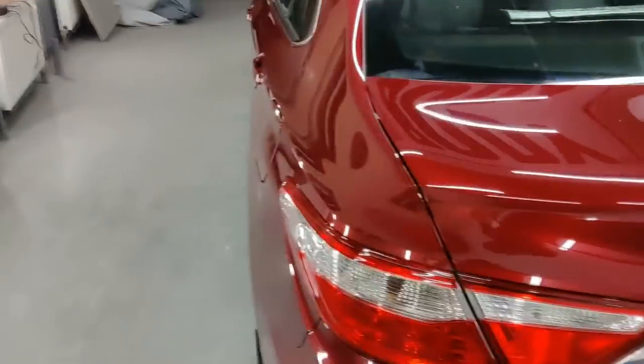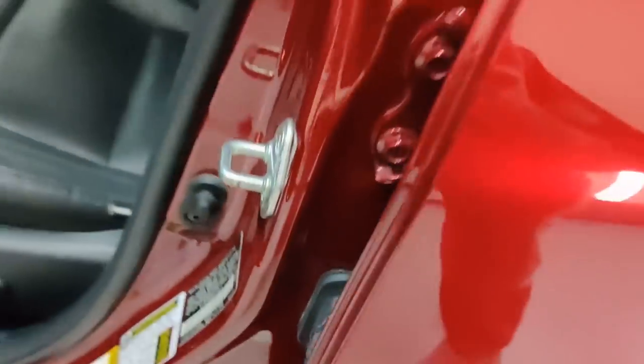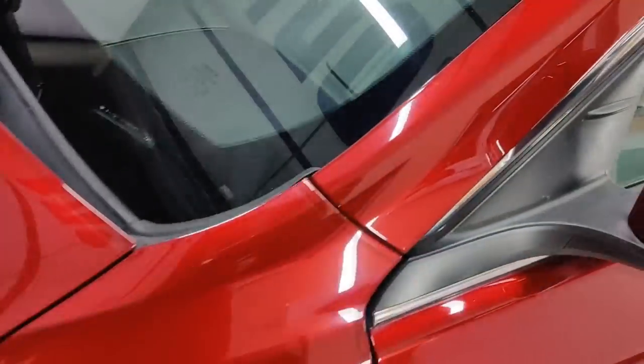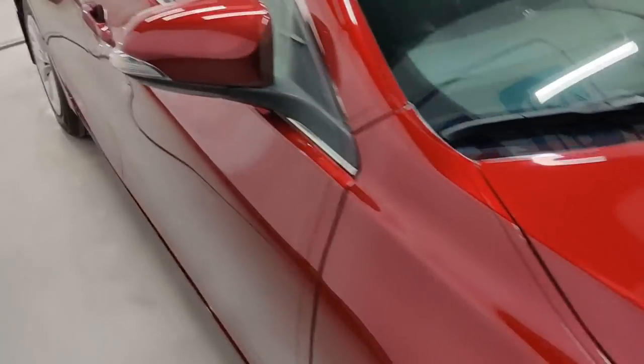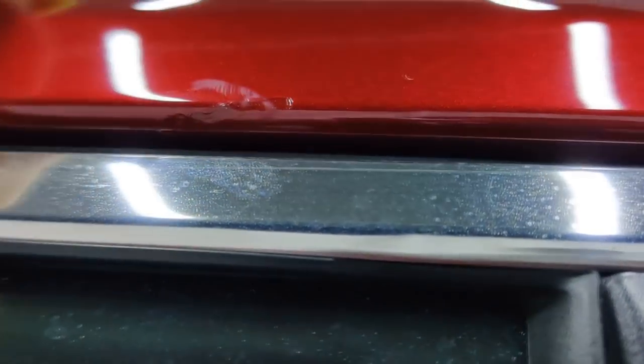The machine is polished. Being prepared dry now. Will degrease shortly. We'll do another pass, correct a few more spots. There are places like this little dot — it's purely base coat. I'll mix hardener and lacquer into the base, 10% each, and go correct it. What wasn't visible at first. In principle, everything is done on the car. The light caught fairly well. There's a dent showing here, but at least everything is in one light.